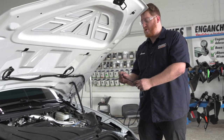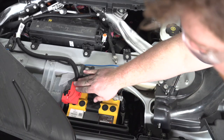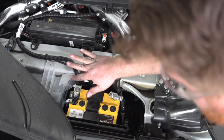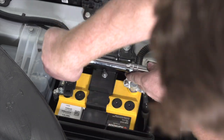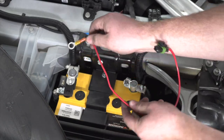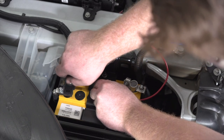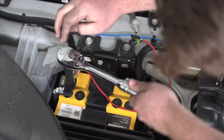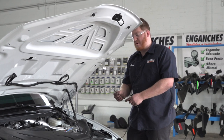We went ahead and removed our pull wire from our power wire and we're going to route it to our 12 volt battery underneath this cross member. Now we're going to locate our positive terminal right here and remove this cover. We want to remove this nut right here, making sure that this post does not come off, using a 12 millimeter socket. Now we're going to attach our fuse holder — attaching the terminal to that post — and reinstall the nut with the same 12 millimeter socket. Then we're going to connect our power wire to our fuse holder; with our U-Haul exclusive power wire, all we have to do is plug it in.